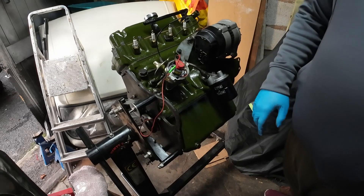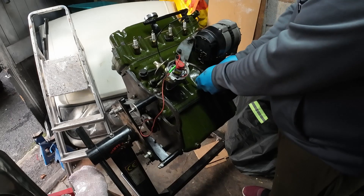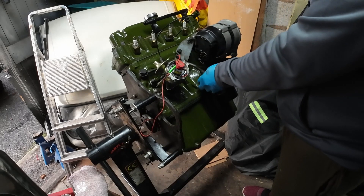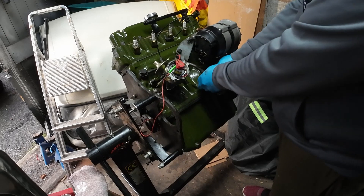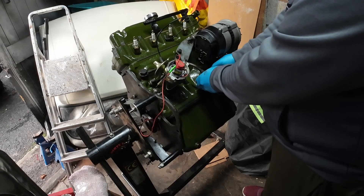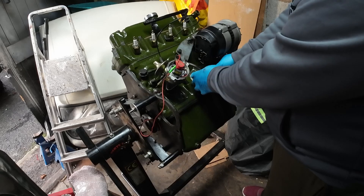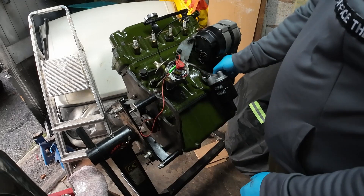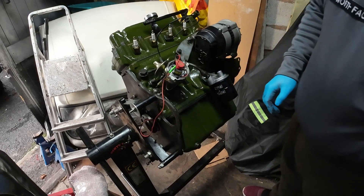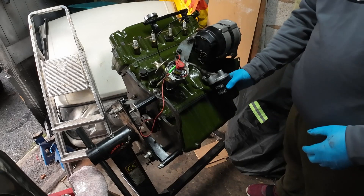Because this is an English all-Imperial setup, it's a little bit confusing. I've got some Hylomar Blue on this because I just wanted to get the filter on to bung up the hole and try to keep the moisture out — because this isn't exactly the driest garage in the world. I've also been rotating the engine every few days to keep the assembly lube moving around.